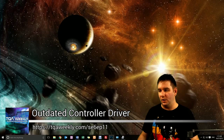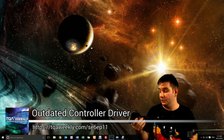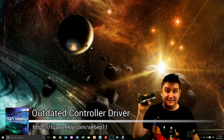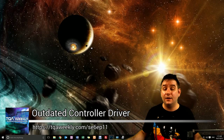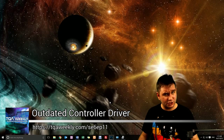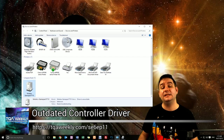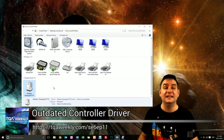Welcome to my desktop. First of all, once the controller is plugged in — if you have this particular controller — please make sure the switch is in the D position, not the X position, otherwise it won't work. Once you're on your desktop, open Devices and Printers just to confirm it is not installed correctly. You will see that in my case it shows as unspecified, which means even the computer does not recognize it as a game controller.